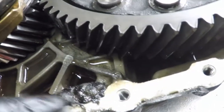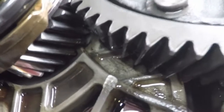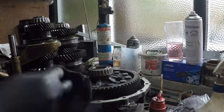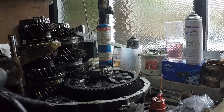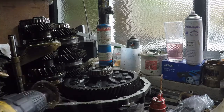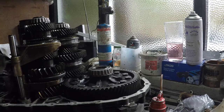We can just see the magnet in there - see how much debris it's caught. There's no big chunks - that's a good sign, but there's always going to be some. A brand new gearbox gets that; that's why you put the magnet in. Before I glue it back together, I need to clean this outer sealing flange. I'm going to use a wire wheel - always do it away from the transmission because we don't want debris going in, we want it coming out.